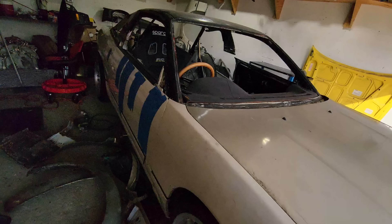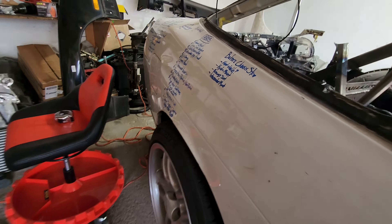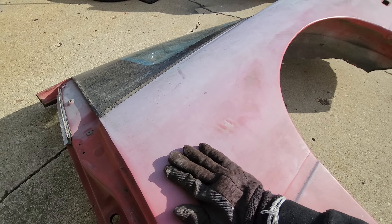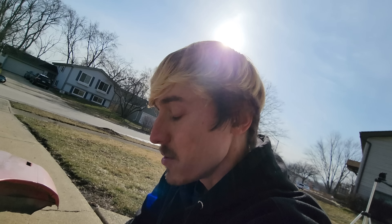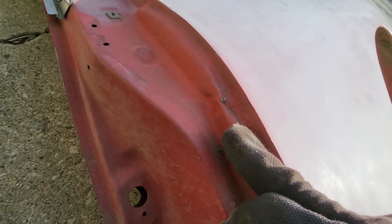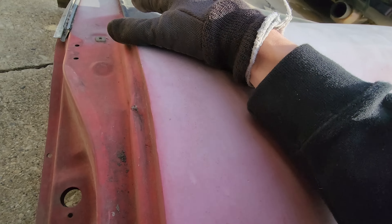Let me show you what the body line looks like just for reference - it's this little guy. This one has no body line. You can kind of see where it was. But when I put my hand on it, even through the glove I can feel it - it's kind of bumpy and wavy, which means it's full of Bondo. So now looking at this more in depth, it's filled with Bondo, it's probably damaged. Right here you can see a little crunch. That does not look too good, and there's body filler in the crunch. You can see this line is a little too crisp - it's supposed to be rounded out nice and soft, but this is like to a point.